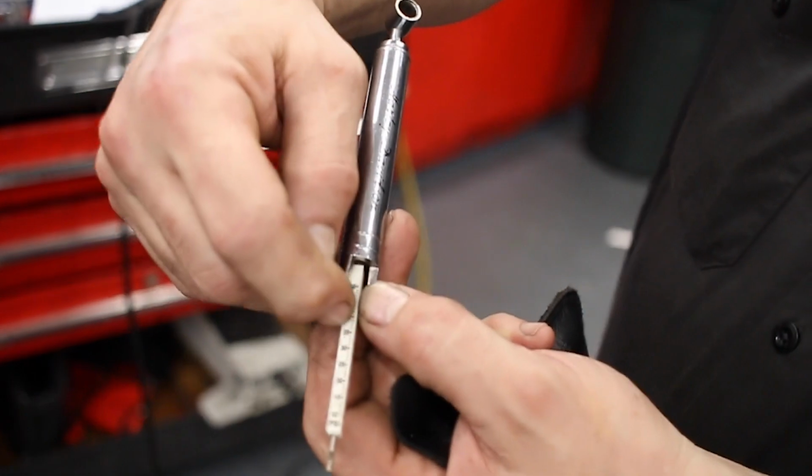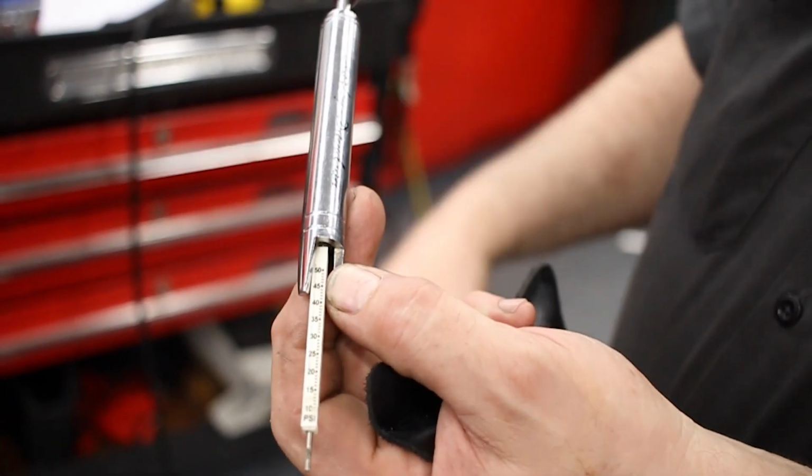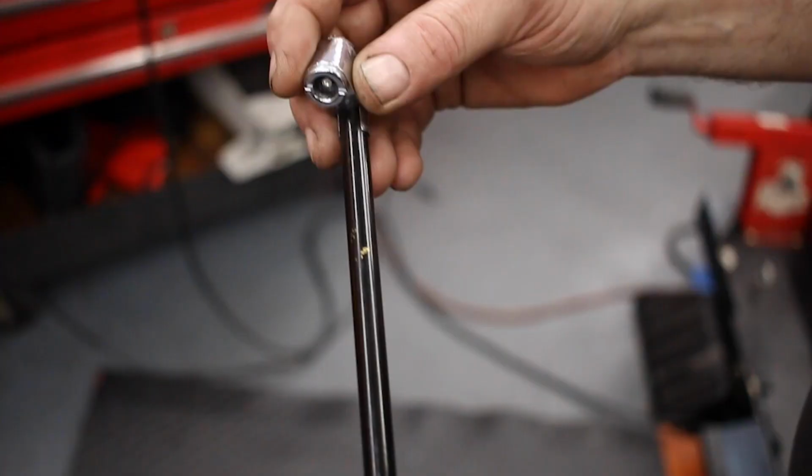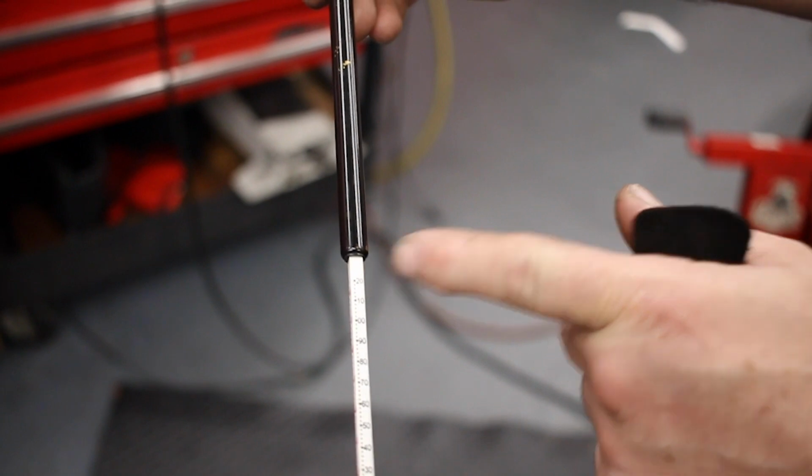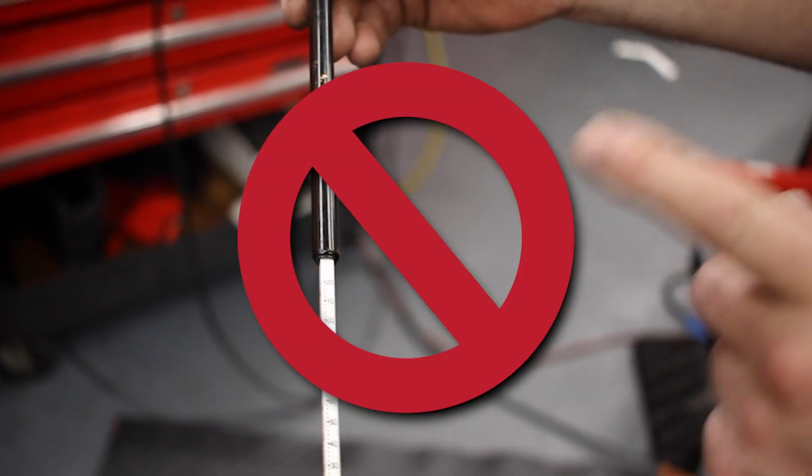If you don't like spending lots of money for tires, then you should go out and invest in a good tire gauge. A good tire gauge for a motorcycle should be a gauge that reads from 0 to 50 psi. Not a truck style gauge that would read from 0 to 120, because the 0 to 50 will be more accurate in the range that Harley tires are meant to be inflated to.